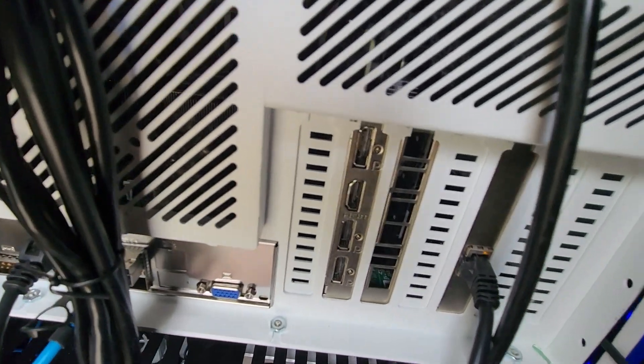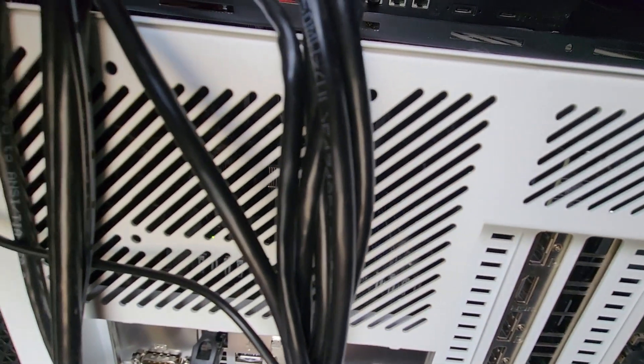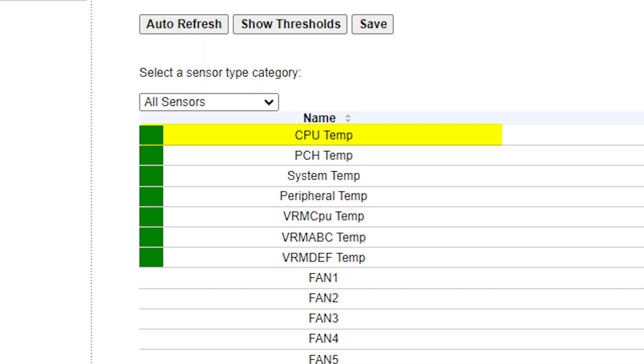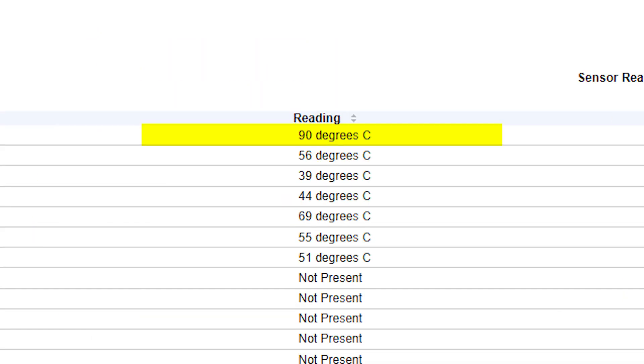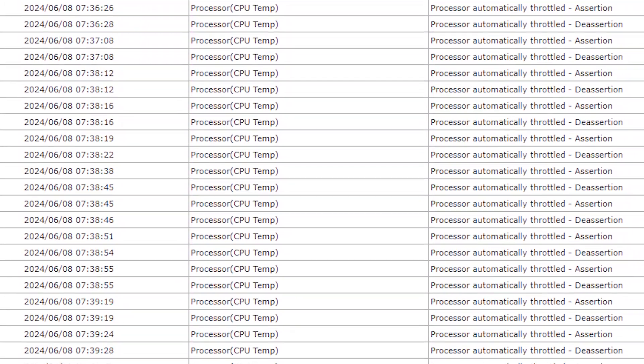What is that? Why is it making that noise? It was at this point he knew something was messed up. That beep didn't sound good, so I logged into the IPMI dashboard and looked at the sensors page to see if it was overheating — and 90 degrees Celsius isn't good. It turned out the CPU had been throttling on and off for days.